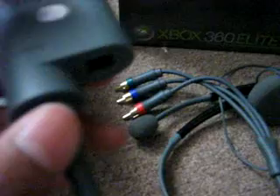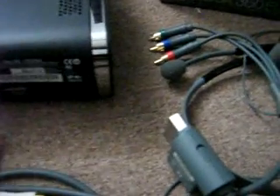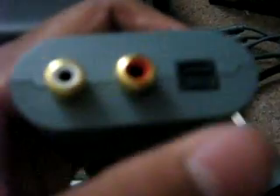One note: the PS3 can support HDMI 1.3, which is one advantage of having the PS3. Also, for the multi-AV connector, you have a fiber optic port for fiber optic audio, connectable to any audio stereo or surround sound system. Note that this also does not provide Dolby TrueHD — only surround sound. If your TV's HDMI doesn't support audio, you can use this connector alongside HDMI to get audio from the standard RCA jacks or the fiber optic port.